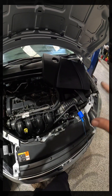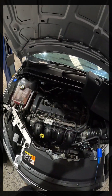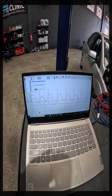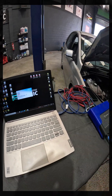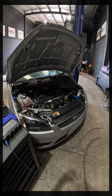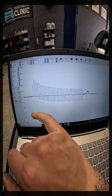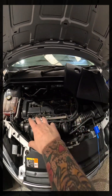The main thing to remember is that a pressure pulse sensor does not give you an accurate pressure measurement. You're not going to use it to look for a specific pressure reading because it has a slingshot effect. All you're looking for is evenness and a smooth pattern — a waveform that is even across the board. That's the main thing you're going to want to look for with pressure pulse sensors. We'll move on to pressure transducers next. That is our good intake capture — no deviances in the valve train or at least these four intake runners.